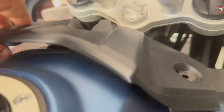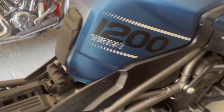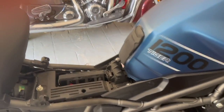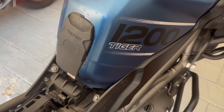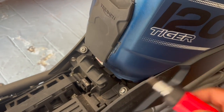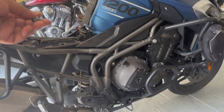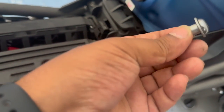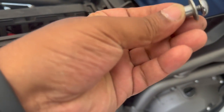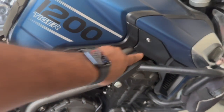I've removed those and this panel comes off loose. There is a cigarette lighter port where you can charge accessories connected — I don't think you need to disconnect that, so I'll leave it for now. Next we're going to remove this plastic panel. For that you need to take out your seat, which will expose two 5mm bolts. I'm showing the right-hand side; the left-hand side is exactly the same. There is also a washer — make sure you don't lose that.